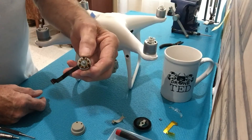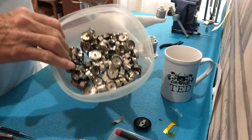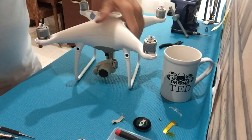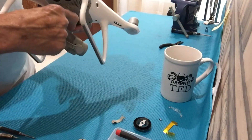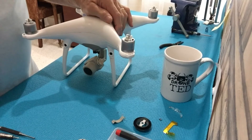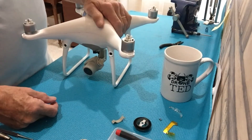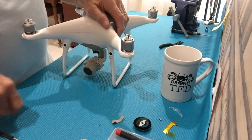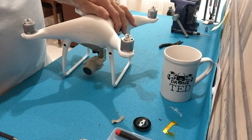As I said, I recommend buying it without the casing. If you get it with the casing you'll have to take the casing off. As you can see I replace a lot of yaw motors — these are the casings that came with them. I keep them because on the back of the arm, right underneath here, is the encoder for the yaw motor. If you have to replace that encoder, the casing on the motor will no longer line up, and you'll end up with a camera that points left and right again. I can then try one of the spare casings, swapping them until I find one that makes it point straight ahead — sometimes that takes hours. Thank you for watching; I'm Ted with DroneTed. Contact me anytime if you have questions, and please subscribe to my channel.